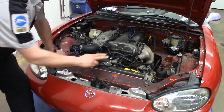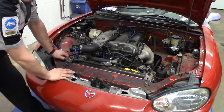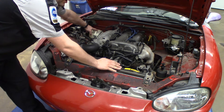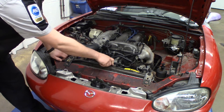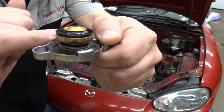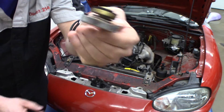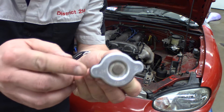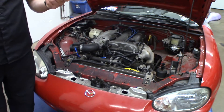First thing we got to do is go ahead and remove our radiator cap. This vehicle has a radiator with the cap on top; other cars might have the coolant reservoir over here with the cap on there instead of on the radiator. This car still has the cap on the radiator. This is called a bayonet cap — it's got two lugs on either side that hold it in place. Looking at the cap, this one says 16 pounds, so this cap is good for 16 pounds of pressure.